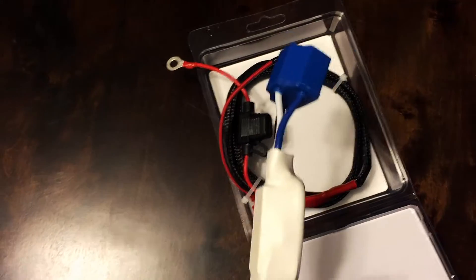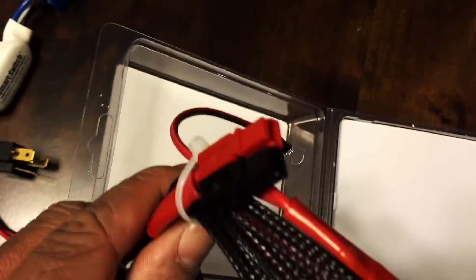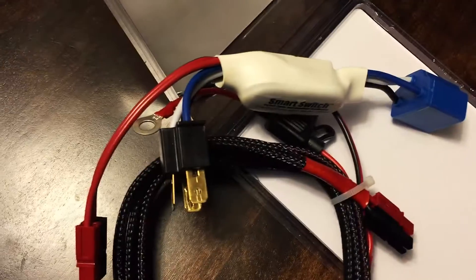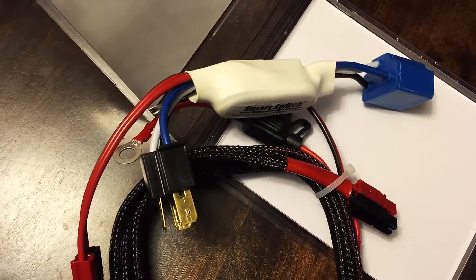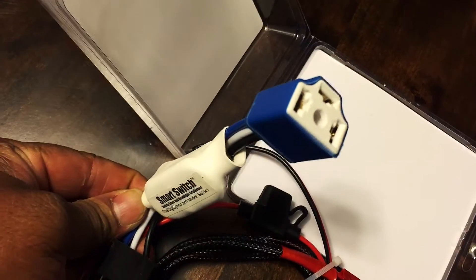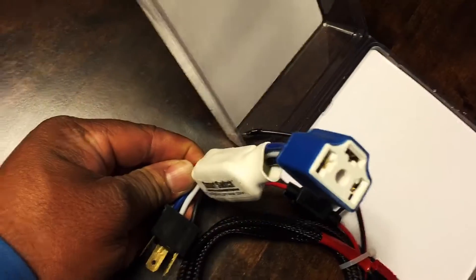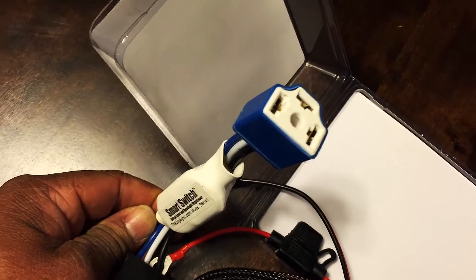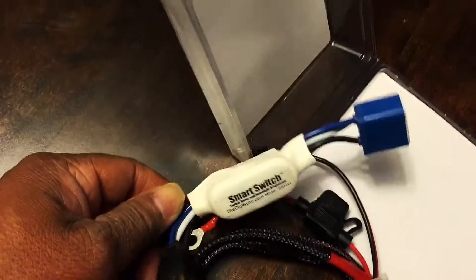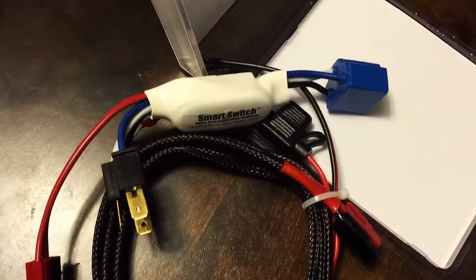This makes your headlight brighter. This piece connects to your battery post. Along the path in that circuit you've got your horn, your starter switch, your turn signals, and maybe some other things too. All of those smaller circuits end up stealing some of the current away from your headlamp. On top of that, those smaller devices can't handle the current that your headlamp is constantly drawing, so over time they end up failing. For quite a few riders, this should fix that.